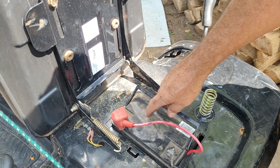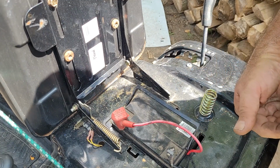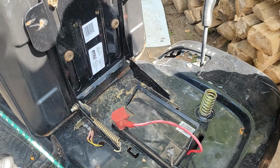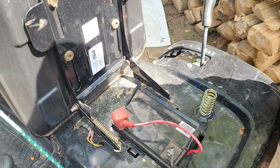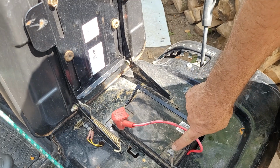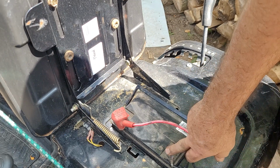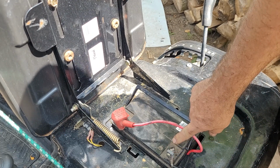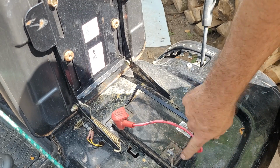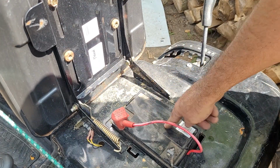Put a battery in. I gave a hand-me-down AGM battery, and I'm going to put the new one in mine, because no one will pay you extra for a new battery versus a good battery. So that's been proven for everything I've ever sold. I put stainless hardware on there. Be kind to the next guy, because maybe the AGMs aren't so bad, but the regular ones are going to get corroded and turn bad. And the way to get it off easy again, use stainless steel. So got that. Link in the description of the AGM batteries.